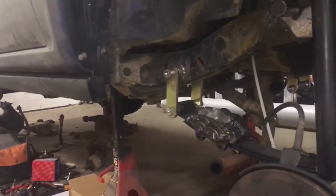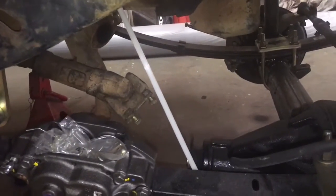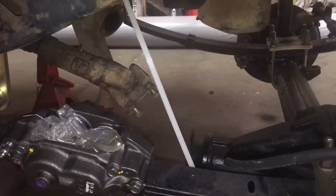We're going to make it so it can droop a little bit more, because right now that's the furthest down the drive shaft will go and it's missing it by probably six or seven inches as far as droop. We know the length is incorrect — we're gonna get that lengthened up at a local drive shaft shop.